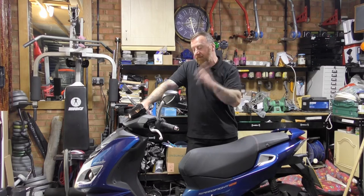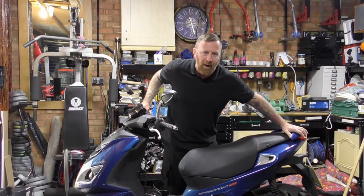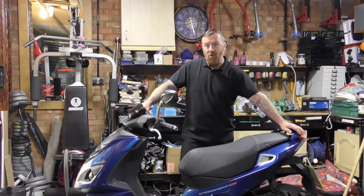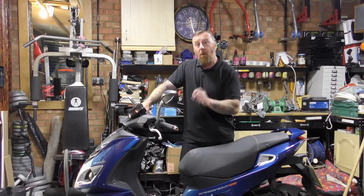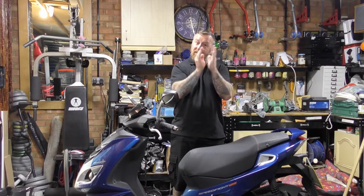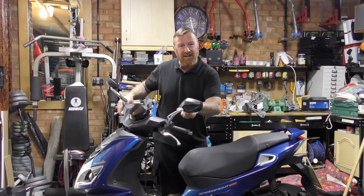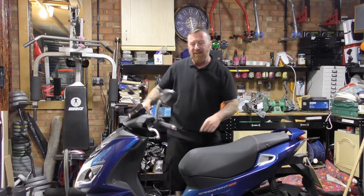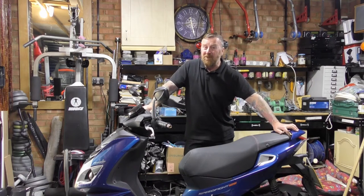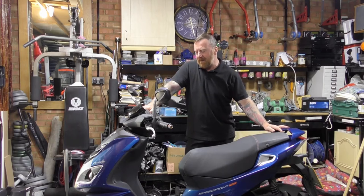The mirror is going to come off and the brake levers are all going to come off as well. On the older ones — and I've just done them on the Mark III I had, video coming out very soon — these are four-pot calipers, so they've got four in there. The old ones used to literally just have one slide out and push against the other side. Seems very much over-engineered when they don't engineer something as simple as these other parts. These aren't as popular — you still pay good money for Speedfight 1s and 2s and then get a 3 cheaper. It's mental.